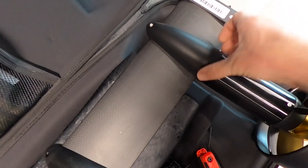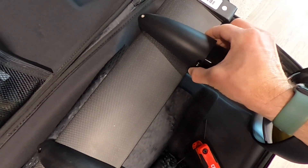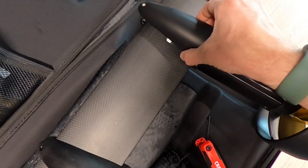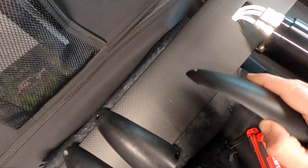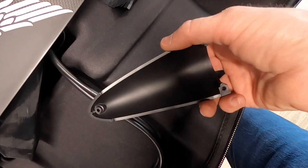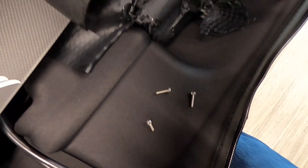We're just going to loosen up all these bolts and slide the fairings off. The back end of the fairing is actually keyed into the front of that motor. There are two slots on either side that kind of key in. You can see on the inside of there it just slides right on — see those two little keyed areas? It just slides on like that.